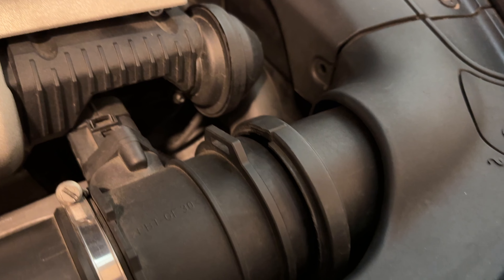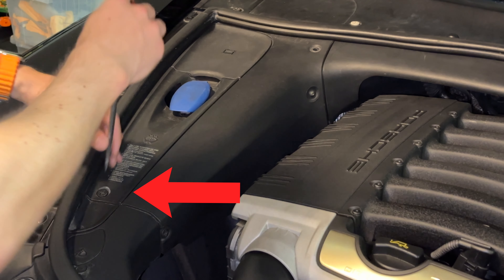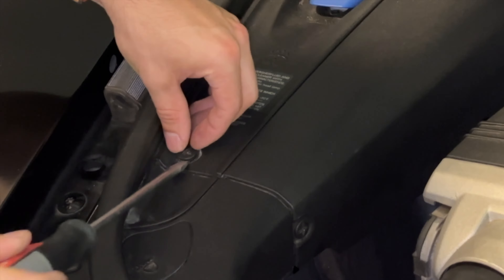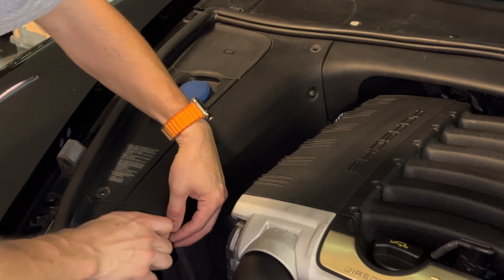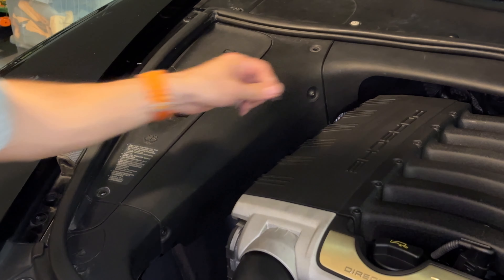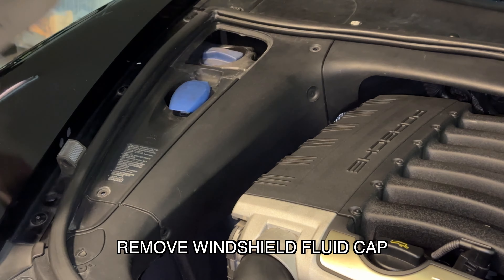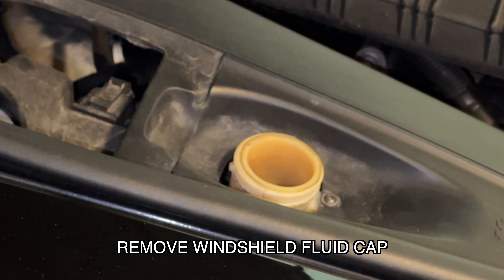These clips just came right off on the air intake. Step one: remove engine covers. On all of the covers, there's a variety of either plastic flathead screws or Torx screws. Starting with the left-hand side, we remove the flathead screw — you can pop it underneath to get it out. There's also a plastic screw here that a short Phillips head makes short work of. There's a screw here — mine's missing. T25, T20.